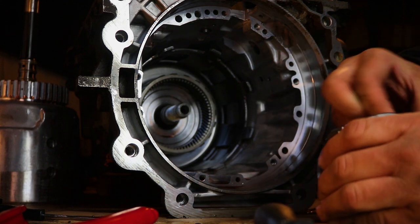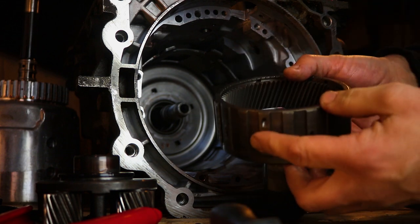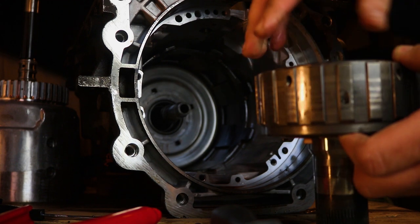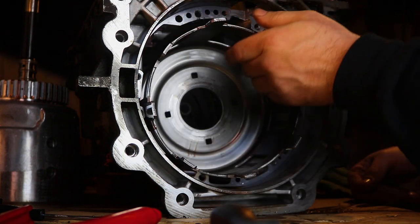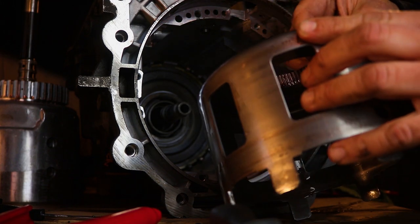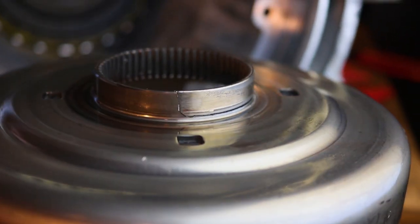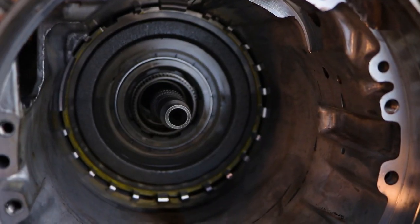Planetary gears coming out — I'll have to check those out and see what the tolerance on those is. Here's the planetary housing — all the teeth seem like they're in order, and the bearing races look not too bad. Put that assembly off to the side. Sun shell time. Wow — this thing is still in one piece... oh no it isn't. This piece is notorious for breaking right along this seam. Either this piece breaks from the other, or the teeth inside get completely eaten up.